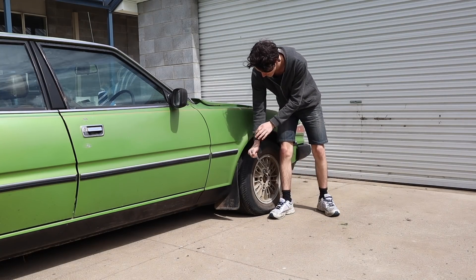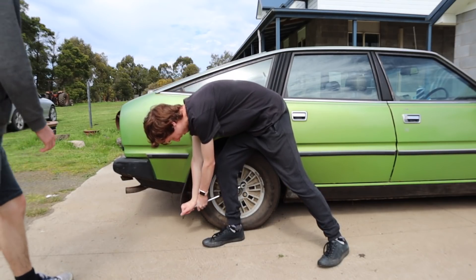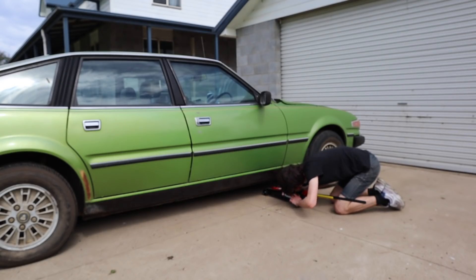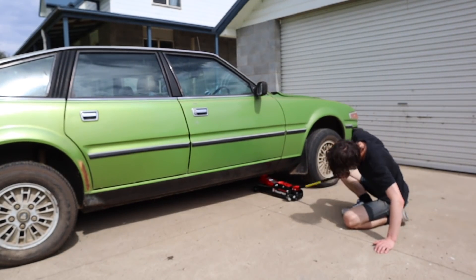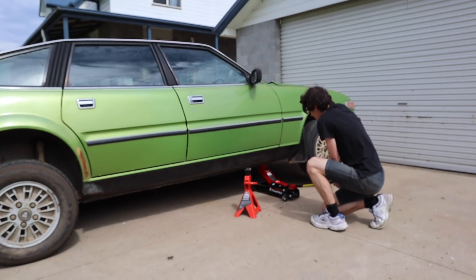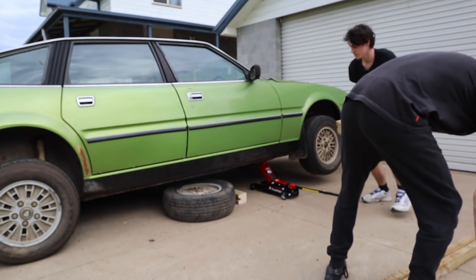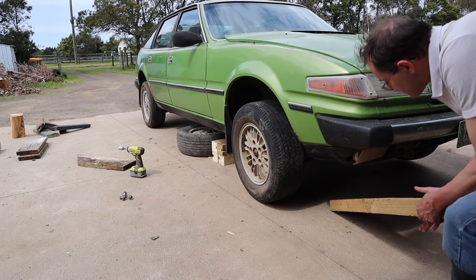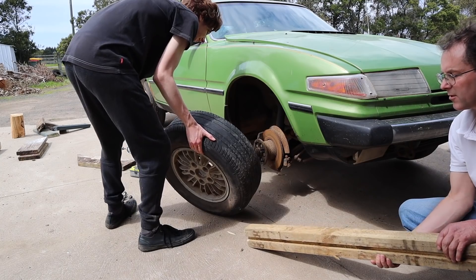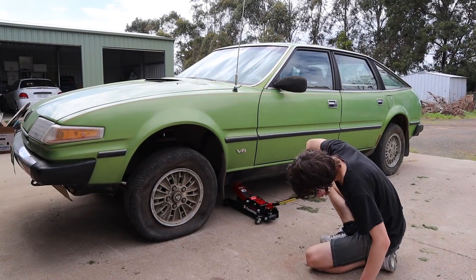With the car onto the concrete, it's time to change over the tyres. I ordered these on Monday and they came three days later ready for install. It's time to show off and undo these lug nuts. This was the only tyre we didn't have to take off and they were actually on there quite tight. With all the tyres and lug nuts loosened, we inserted a jack under the front and started jacking up one half. One problem was there's barely any jacking points on this car, and then the jack stands were way too huge to fit under it — that's what you get for buying truck jack stands for a small car. So we improvised with blocks of wood. With the car up, we took off the front tyre — a little bit stuck, so we knocked it off with a block of wood — then wheeled the old tyres away to load them in the back of James's Commodore.